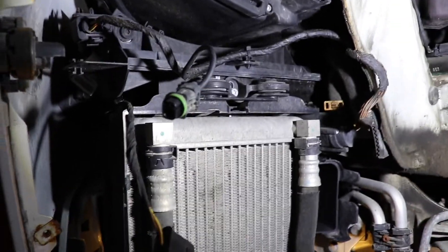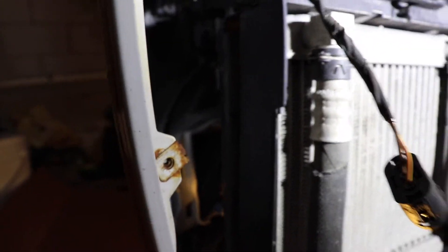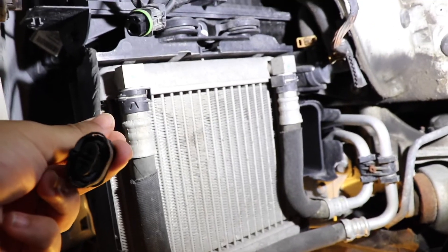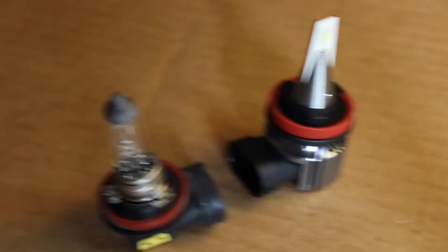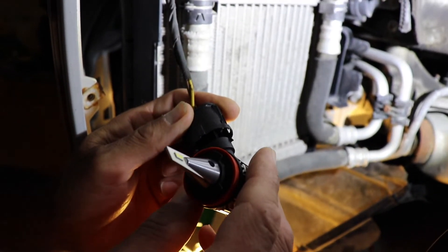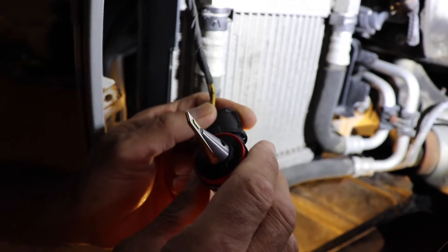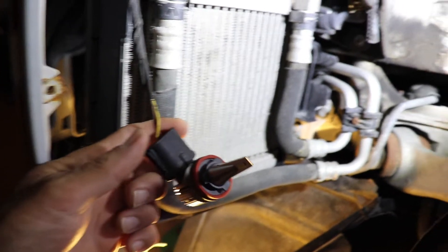We had to take off the whole interior side cover and then open the bumper a little bit — we were trying to get away without opening the bumper, but we had to open a little bit of it. There's a very tight corner where the light comes out from. That's the connector right there. These are the before and after lights — this is what came out of the car, and that's the LED light we're going to be replacing it with. Now we're just going to put it back in. Taking the bulb, putting it into where the old one was — it's a straight replacement. Just like that, it's connected.